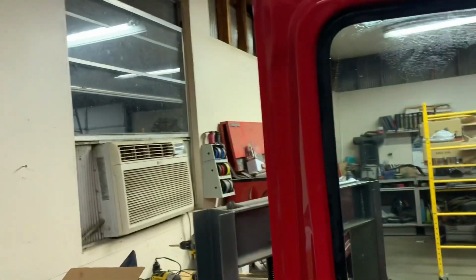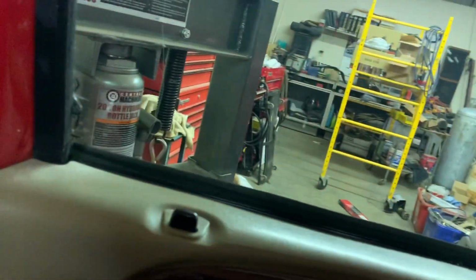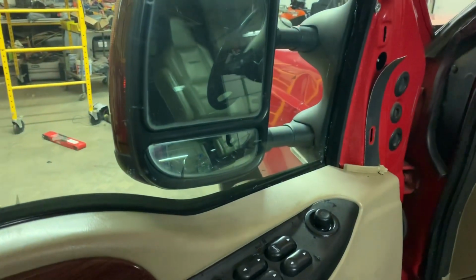All right, guys, so now it's like 9:30, something like that. But I have all of the windows scraped, except for, you know, a few tiny little spots of glue and whatnot. But what I ended up doing is my steamer and some needle nose vice grips with a razor blade on the end of them, and it works pretty well. I still have to get the tint that's tucked up behind this seal and this seal over here. So I'm gonna do some research on that, but for the time being, I'm gonna go get something to eat and, well, probably go to sleep.